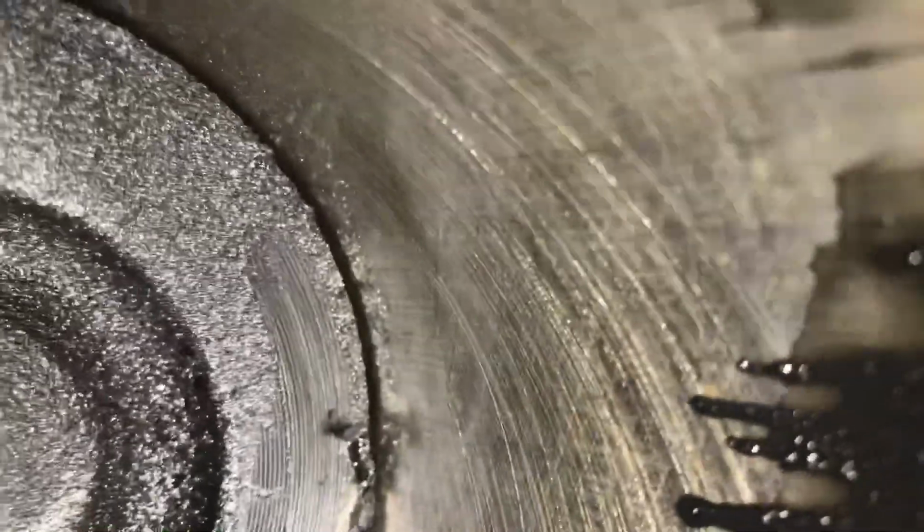That's good. It doesn't look that bad, but you can see the video isn't really picking it up. See all the little lines on it? Those lines won't come off. Those will, but the spots, like the etching, looks like it's etched. This side ain't too bad. See how you can still see the glistening from the crosshatch? Up here, the crosshatch is gone. So,